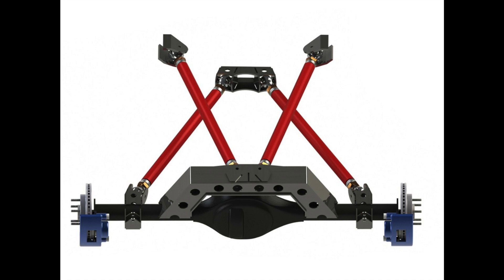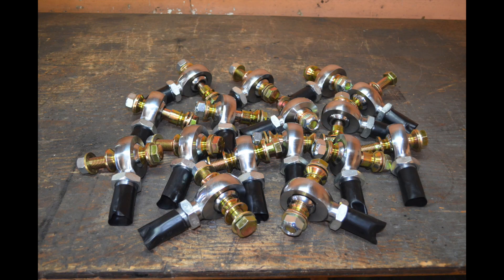I also like to build some really beefy tabs. I like to use 3/8-inch plate for the suspension and 3/4-inch bolts. It might be overkill, but I've had bad luck with 9/16-inch grade 8 and grade 9 bolts breaking on my buggies in the past, so that's why I use 3/4-inch for the uppers and lowers. I decided to go with 1 to 1.25-inch heim joints with misalignment spacers for 3/4-inch bolts, which also come with jam nuts and welding bungs to weld DOM tubing to make your links.